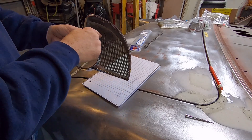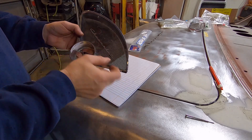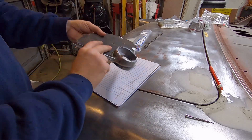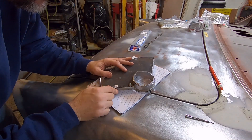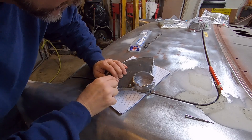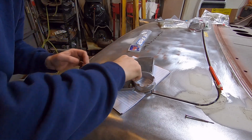If you got a Bel Air, it would say Bel Air in there, and the font is quite a bit bigger. But for what I want this for - a detail item, which I'm going to show you - I need to get this emblem off of here. This is a spare bezel. It has a little push lock nut on it, and what I'll do is take a little pocket flat blade screwdriver and go in here and try to bend up this tab a little bit.